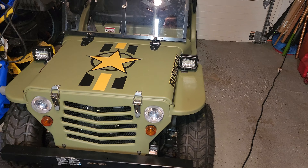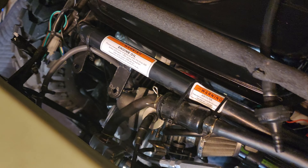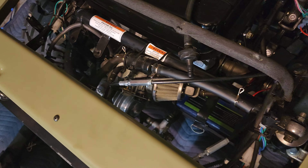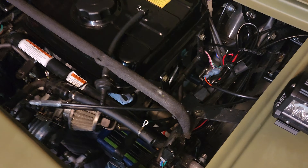You're not going super fast to really get hurt anyway. There's the choke lever — pull it out for choke. That switch is the horn. The gas tank I think holds about a gallon. I also had to do a fuel pump delete because the fuel pump was getting vacuum through some vacuum port and it wasn't pushing fuel through too well — it was sputtering and stalling out. So I just took it off and we're doing the gravity method now.